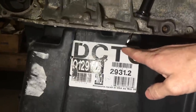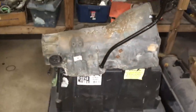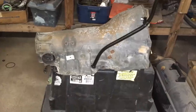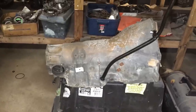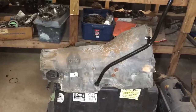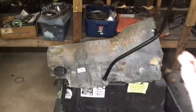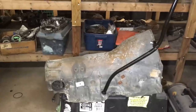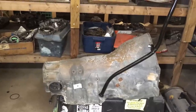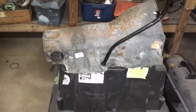I've taken off pans before where the full mark is three quarters of an inch to an inch below the pan mating surface. In a daily driver that never sees the track, it's not ideal but you're probably not going to see as many issues. But in a race application with a trans brake — where you let off the button and it instantly sloshes all the fluid to the back — if it doesn't have enough fluid it will suck the pan dry, lose pressure, and burn clutches.